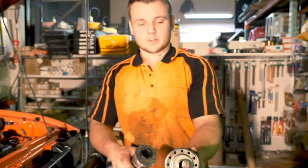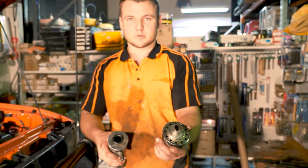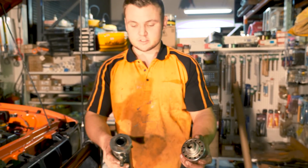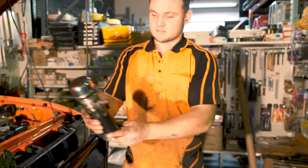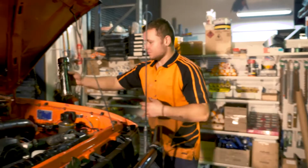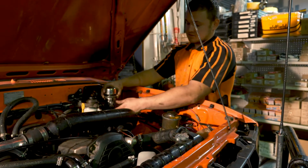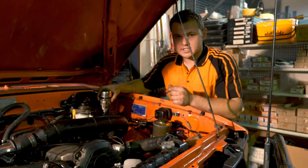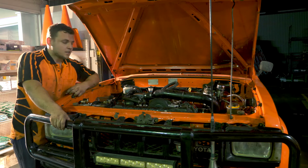That's an old oil breather cap off an old Holden motor, or you can buy them brand new from Autobarn, Repco, whatnot, for like $20. Just drilled a hole for a rubber grommet, goes in there. Just mount that up somewhere. You run your hose into there. $0 catch can. Little extra things I did to this motor to pretty it up while I was building it.